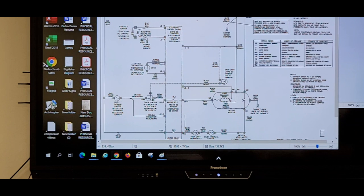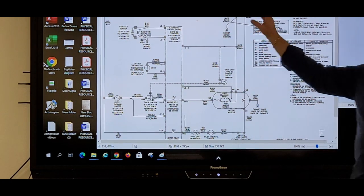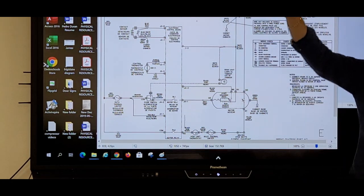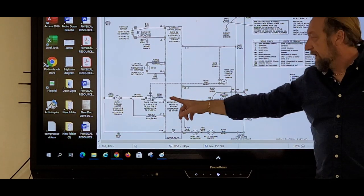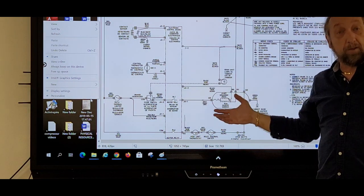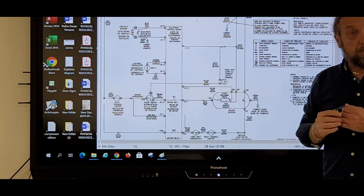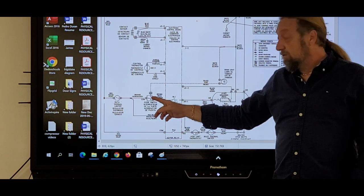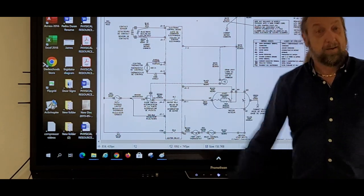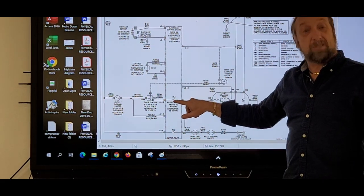It's going to continue to run. Is the heater going to work? No, let's say the machine has proper power. The machine has 240, 120 all day. We determine that we have power coming into the board on this relay, but we don't have it coming out. That's why the motor's not running. So we run a piece of wire here to jump it out, and the motor's going to start. As long as the door is closed, I can open the door and the motor stops. Close the door and the motor will start running again. I don't have to press start because pressing start closes that relay.